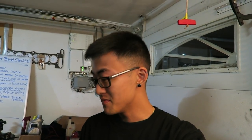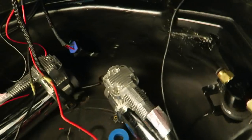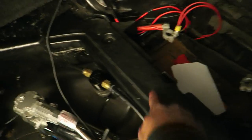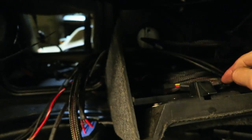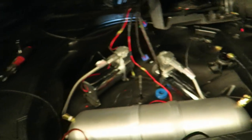The wiring and all the plumbing, air fittings and stuff, is all mocked up correctly. I didn't mount anything down to the spare tire unit just yet — I wanted to verify that everything works first. I also need a spacer for this bracket because the drain fitting is hitting the bottom of the spare tire well. The power wires are all spliced up through the power cord of the car. I wired all the ground terminals to the other end of the terminal for the battery itself so it hides underneath the plastic tray. All the air hoses are bundled up towards the top and feeding into the controller, and all the wiring is bundled and hidden back here. I'm going to create a nice plate to remount the amp for the sub. The wiring loom will be here for now, but I might relocate everything to make a channel as I customize this trunk layout to suit the air setup.